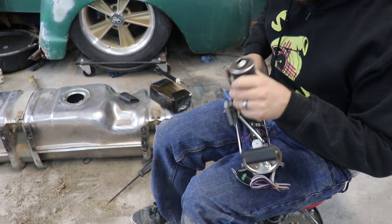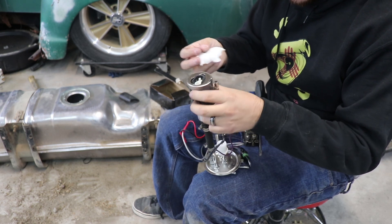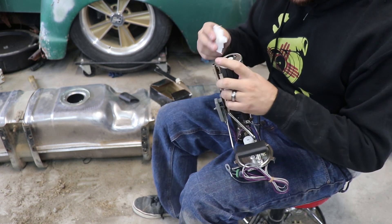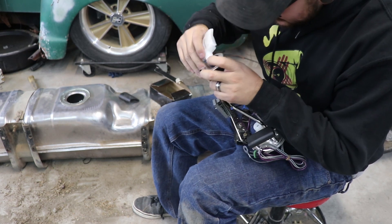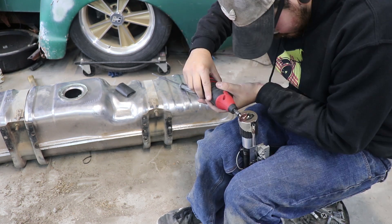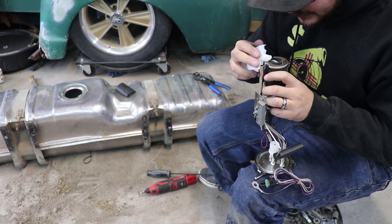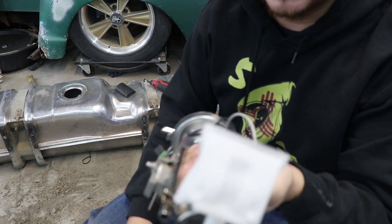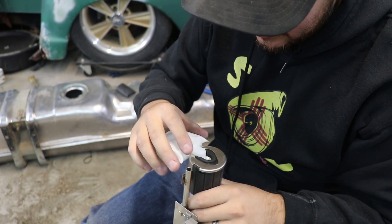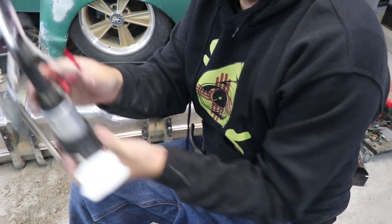Here's always the big issue — I think my fuel pump is actually backwards. It's got a little cutout there but that's going to rub. I might just have to take a notch out of this cage right here real fast, since obviously a different strainer would have gone on here for a completely different pump. I ended up just notching out a tiny portion of that metal cage, and the strainer is on there. It's a little loose, but I don't see any other way it would have worked. There's our fuel pump assembly.